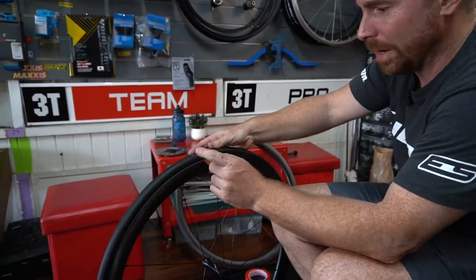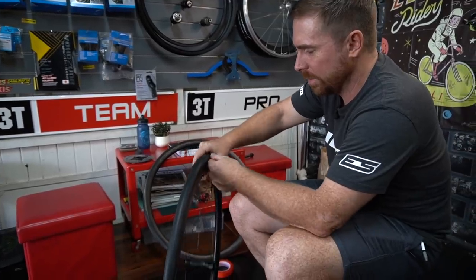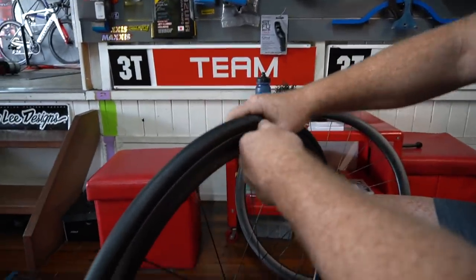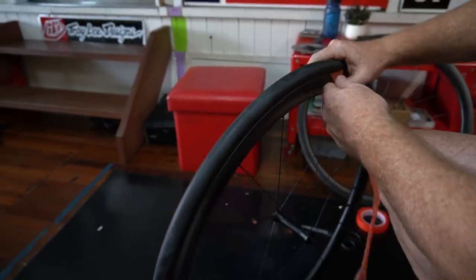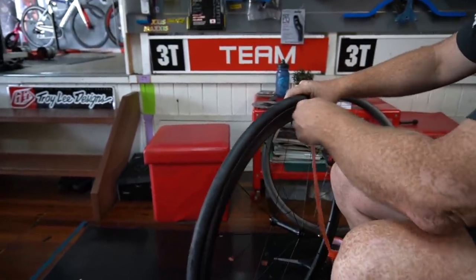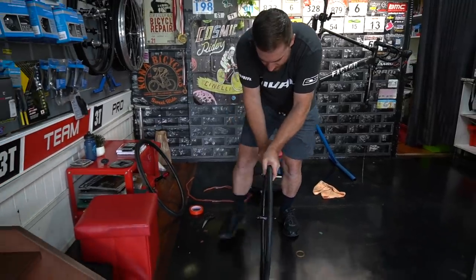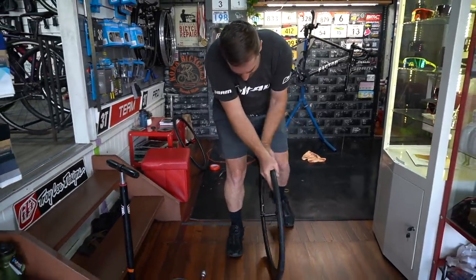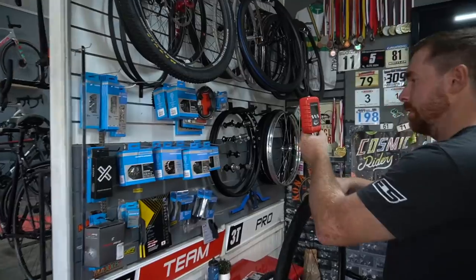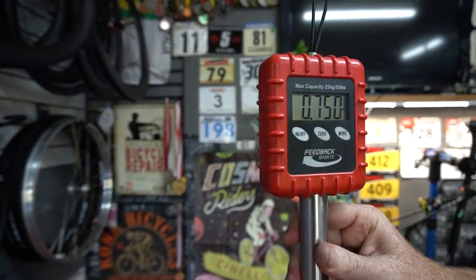Now you've got that tape that you pulled out earlier — if you didn't pull it out, you'd have to take the tire off again. So now it's just gently, very slowly. You can do it with a two-finger pinch. Because you've got plenty of pressure in there the tire's not moving, and you don't want to pull this way — you've got to pull backwards. I find that really helps the tire run dead center. That's a light wheel with the tire on it — that's the front.